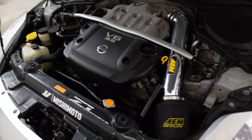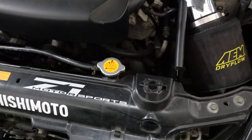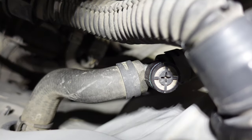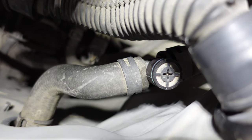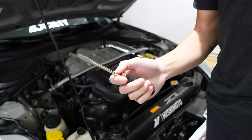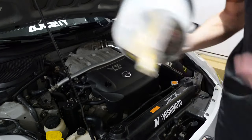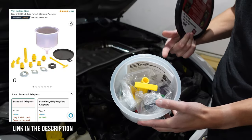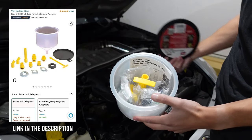The camera actually died while I was putting everything back together, but now we're moving on to bleeding the system. All we have to do is fill it up with enough coolant to make sure it comes out of the bleeder screw that's back here. You can use a Phillips screwdriver or a flat head to open it up, and you want to make sure it overflows out of this spot before you even turn the car on. This is also the funnel I'm going to use to attach to the radiator. There are a bunch of different attachments in here — they'll most likely come with the specific attachment that works for your car. I'll make sure to link Anthony J's YouTube video in the description below, as that's where I got all of this information from.